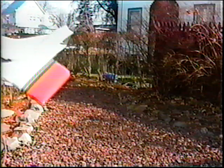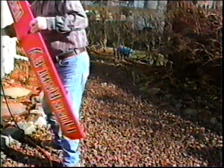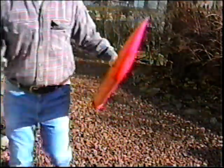But I don't want to put more than 10% retarder in. This is a pretty good way of checking before I paint the wing. I wouldn't want to have the whole wing fog up. If this part fogs up, it's not the end of the world. It's a good little thing to have a little part like this. We are really fortunate in having this day.